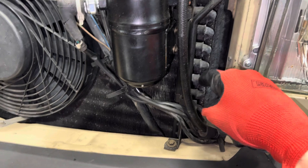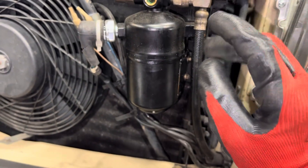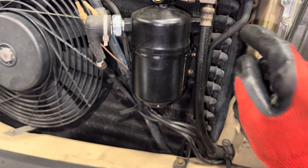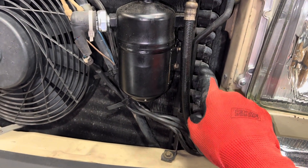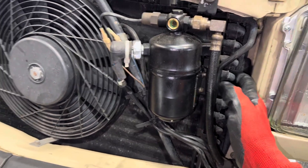At least you'll get the debris out. These tubes are three-eighths of an inch — not the smaller later-model European condensers with six-millimeter tubes. The six-millimeter tubes had problems getting plugged up with piston ring fiber material — long strings that would get caught in the bends. So you couldn't always flush those out. Usually with three-eighths-inch tubes you don't have a problem flushing.